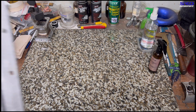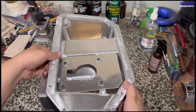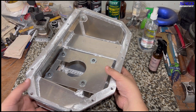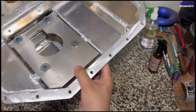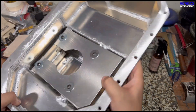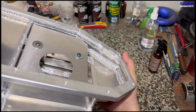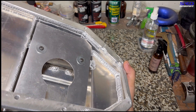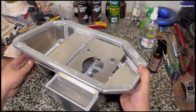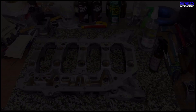Let's start with the K Power Industries oil pan — the rear wheel drive oil pan. The aluminum is really thick, so it's durable. The interesting part is those trap door mechanisms, which prevent oil from sloshing left and right when turning. This has been done for ages with track car guys not running a dry sump. Really cool.